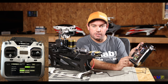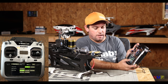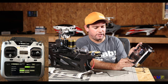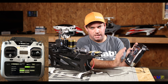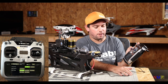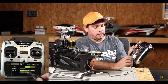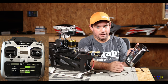If you have a standard digital servo — like a generic, most brands — 285 DG Hertz is correct. If you have completely analog, non-digital servos, you want to run them at AN 70 Hertz. If you have servos marked as digital 95 Hertz or digital 140 Hertz, take note of that and make sure you've got the right setting. Most of today's popular helicopter cyclic servos are 285-capable. In this case, Futaba has a great feature of being able to use 760 neutral, so we're going to click that. You're going to see everything is now alive — it's all going the wrong direction, but we'll fix that in a second.